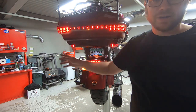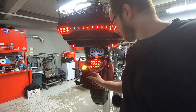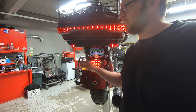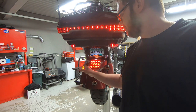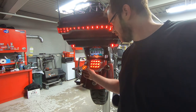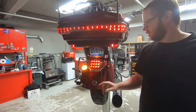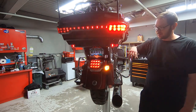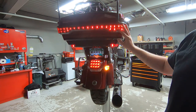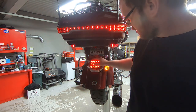We have the left turn signal working. Same thing - you want to look at the way that the filament is in the turn signal. In this particular vehicle configuration it's only a single filament rear turn signal bulb, which is kind of unusual but that's the way it works on this year vehicle. You want to make sure you have the right bulb plugged in the right way, and while it's illuminated you're also looking on the back of the reflector for signs of water intrusion. Everything's looking good there. Make sure that everything's working on the tour pack and that you don't have any dead LED cells. And you want to make sure that your license plate light works - and it does.